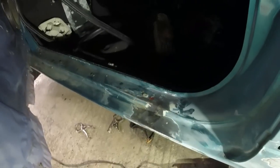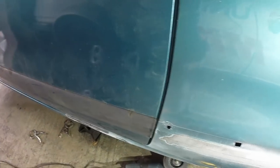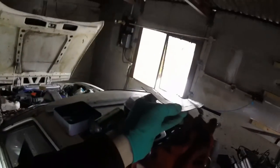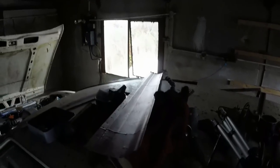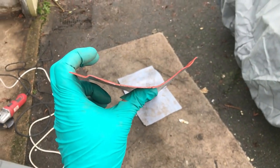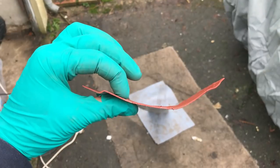Patch is now in. I've again not ground it down silly because it doesn't need to be - it'll be filled anyway. So got to go get the seal and offer that up and work out how I'm going to attach it. Incidentally that has been all painted, primered, nice and straight. Spoke too soon - there is a bit more work to do on this seal. In the last video I was explaining how the profile on the car wasn't the same as my repair sections.